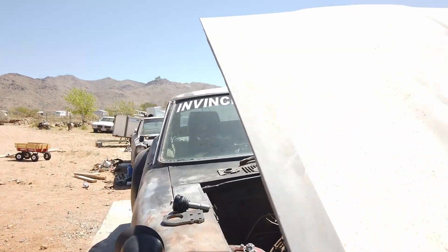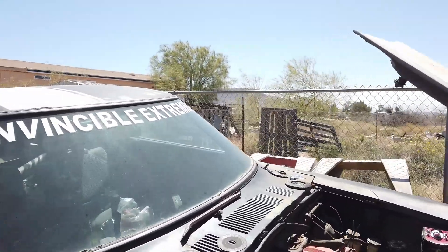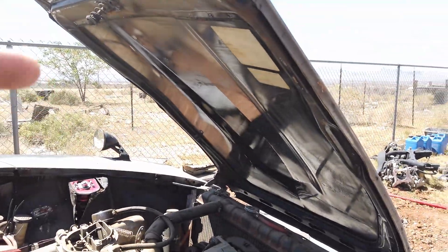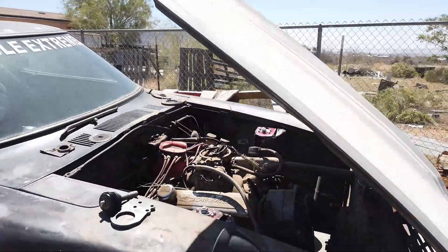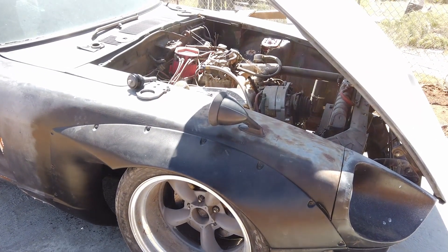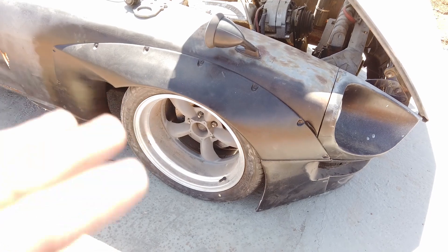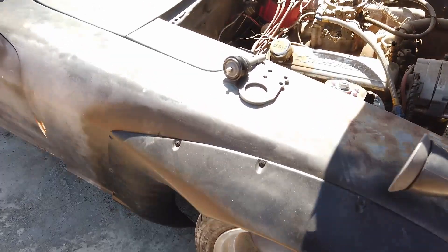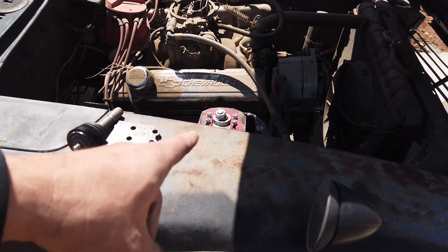That's not a practical low, but as you can see at the end of this video — with Datsun suspension, even using those flimsy aluminum spacers, you'd be right at this height, which is really not possible without airbags or something. To gain caster, I moved the shock tower back two inches.